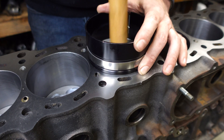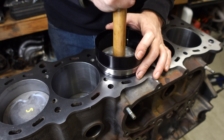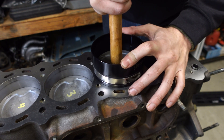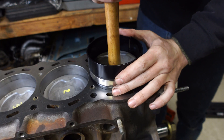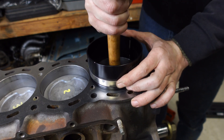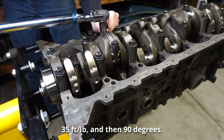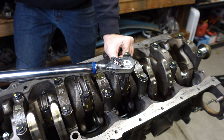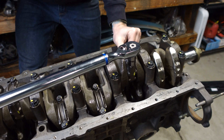As I'm sitting here editing the video, I realized that I lost some footage where I was explaining the current status of the motor. Basically this is as far as we're getting because I'm waiting on a bunch of parts from Toyota, including the freeze plugs or core plugs, the oil pickup tube gasket, dowel pins, and a bunch of other things - not to mention the front oil galley plugs that the machine shop removed and Toyota doesn't make anymore. I'm probably going to have to go with Dorman replacements for those. And I don't have my cylinder head back yet. So the next time you see this motor, the oil pan, timing cover, the freeze plugs, and everything else with the bottom end will probably all be installed.